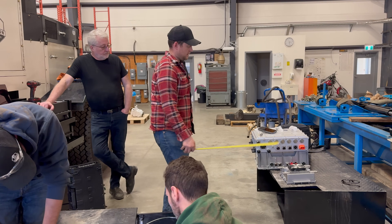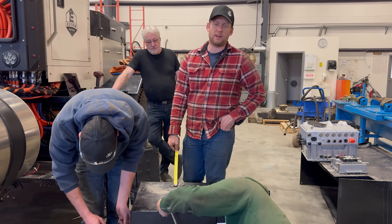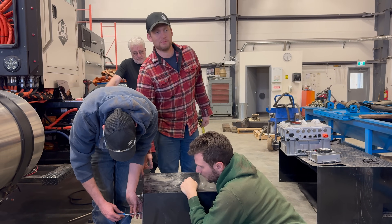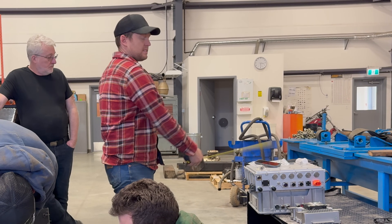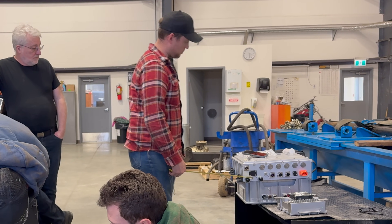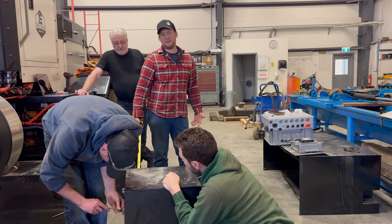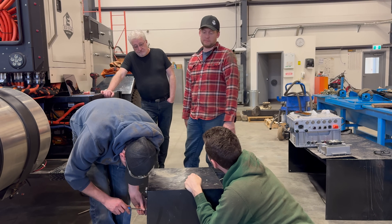We've got a problem. The new 3-in-1 is slightly bigger than the old one — just slightly too big to fit in the old box. We looked all around town and there are no boxes that meet this size; we'd have to order one, which is a couple of weeks away. So what we're going to do is cut a hole in the back and let it stick out. At least the new one is waterproof — the old one wasn't, because it was air cooled and therefore couldn't be sealed. The new one is liquid cooled so it can be waterproof, meaning road spray won't matter. We'll put a cover over the back to protect it and hopefully find a proper box.